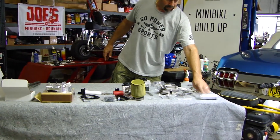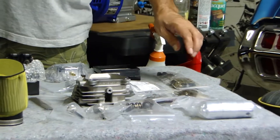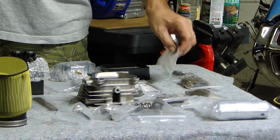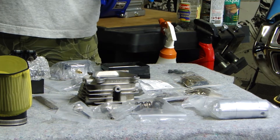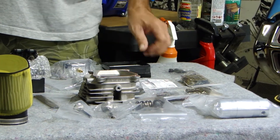We've got a brand new aluminum catch can. I've got all brand new hardware: head studs, side cover studs, valve cover studs, all new header bolts. I've got offset keyways with the flywheel. I've got a couple different ones here because we're going to run a slipstream aluminum flywheel which has 34 degrees of advance in it. I want to play with some of the advance and bump it up a little bit, so we'll test it with a couple of different keyways.